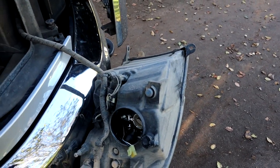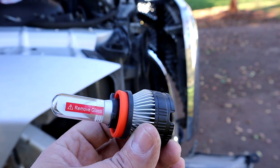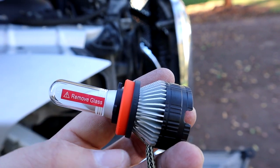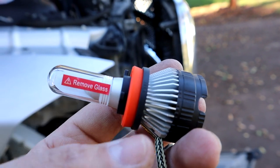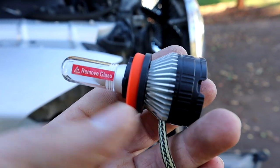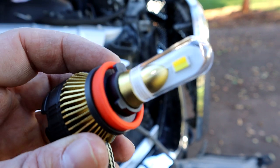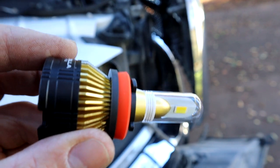Make sure you turn it on before you put everything back together. If it does not come on, completely reverse the plug 180 degrees, plug it back in, test it — should be ready to go. Also, before you install the new LED light, you have to remove the glass that's on the end of the bulb — there's a sticker on there. Remember to remove that glass, otherwise you're not going to get the light output you should be receiving. Discard the glass, and then the bulb simply plugs in just like the factory headlight — pops in, turns, and locks.